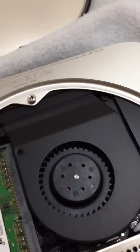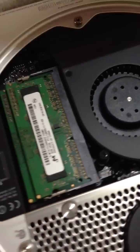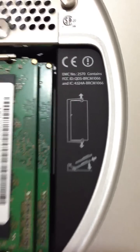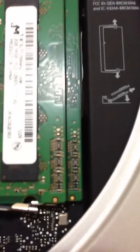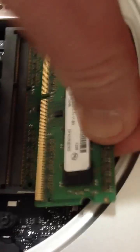These little pins right here, and then there. It shows you exactly — if you didn't read online — how to go ahead and switch that RAM. We'll go ahead and pull these clips, like one — see how it just kind of popped back a little bit — and then this one the same, and this will just pop up like that. So just grab it gently and pull that out.